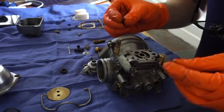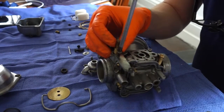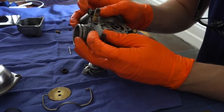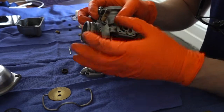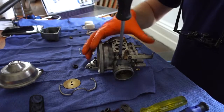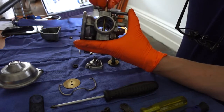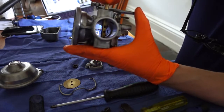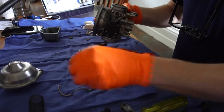So you put the plate on and then replace the two screws. There's a little bit of play in this plate, which I'm just showing there. You basically want to line it up so that there's no friction on the throttle body spindle, and then snug them down. And just showing here that the throttle spindle moves easily, and that's kind of what you're looking for.